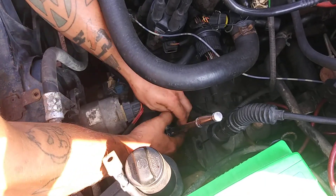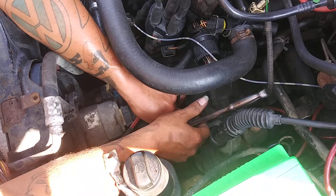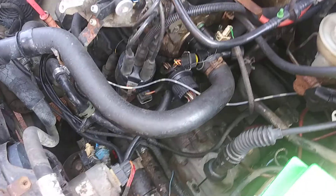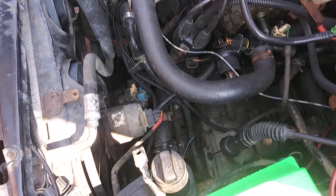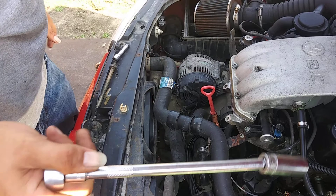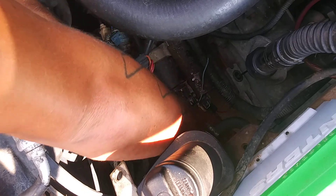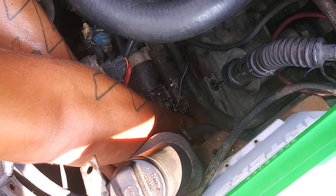Basically, doing the starter is not very hard. It's usually three bolts for the five-speed — I believe it is four for the automatic, or maybe it's two for the automatic, and the mount bracket is different. There's one bolt, and there's some chalky, nasty, milky, oily stuff on it — we'll have to clean that up. Then there's one more on the underside that you've got to get to. Easiest way would be from the bottom, but I'm filming, so I've got myself a nice extension with a wobble end. It's a Harbor Freight Pittsburgh, but for my purposes and what little bit of stuff I do, it does me just fine.